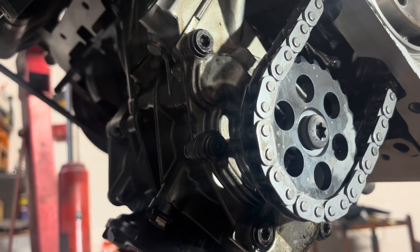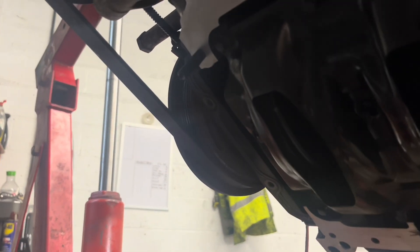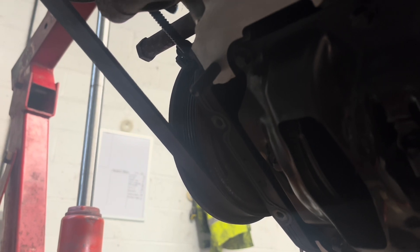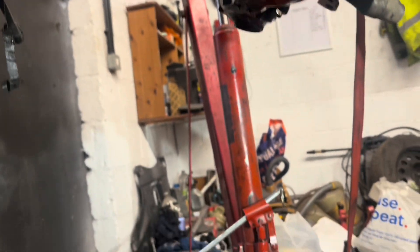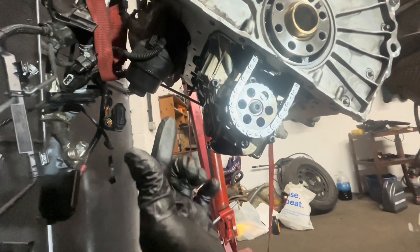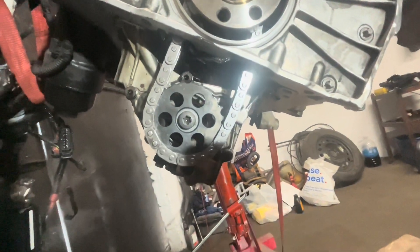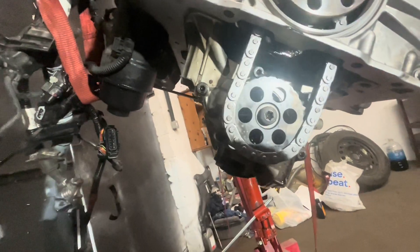I'd like to show you a trick I'm using to put the oil pan back in awkward positions. I created some guide pins — I cut the head off two oil pan bolts and made them a little bit larger. I have one on this side and one on that side. So when I am raising the oil pan with the silicone on, I will align it to that hole and to this one, and that will guide it exactly so it's not going to move or do messy stuff.